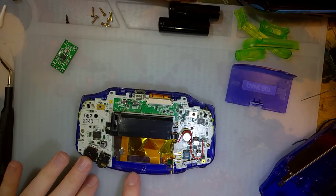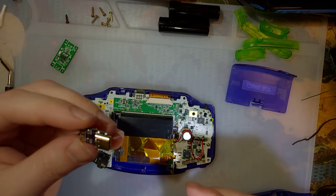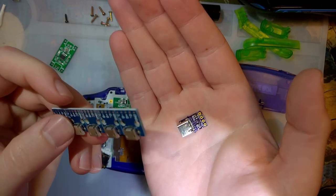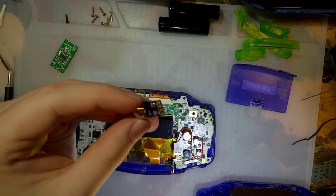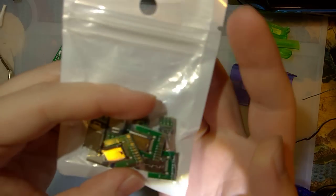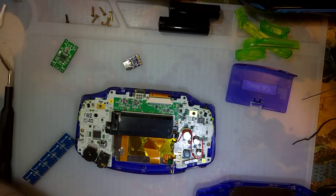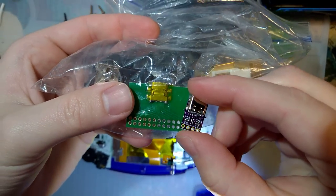The idea is to get a USB port right here in this empty space. I want to use USB Type-C, so I got one of these breakout boards for my choice of USB port. They make them in micro USB if that's what you want. I couldn't find any that I liked for USB Type-C, so I started making my own — I'll make a GitHub repo and upload them. They do make USB Type-C breakout boards, but they're all bigger kinds with all the pins, and you don't necessarily want that for something like this. These smaller USB-C ports themselves can be quite unreliable.